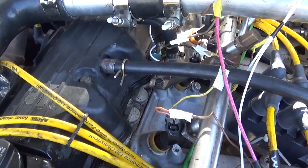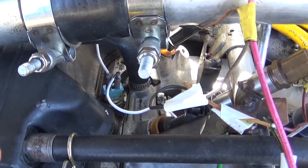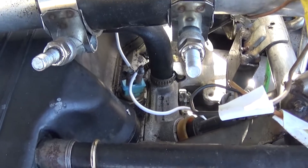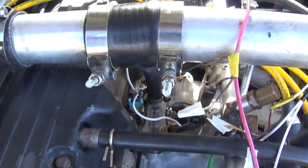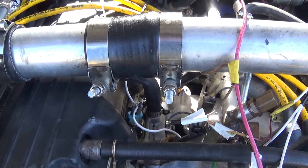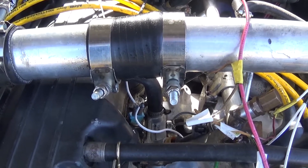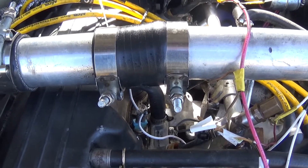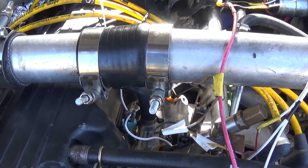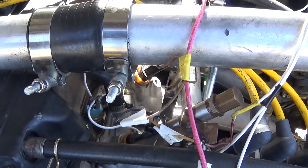The coolant sensor is right here, going to the ECU. You just have to calibrate it to the values that sensor has — I put it in boiling water and took the value, then took the value at room temperature which is my bias, and then took the value at around 32 degrees in the freezer as the low point. Those three points let you really map the characteristics of these sensors.